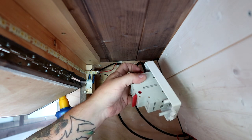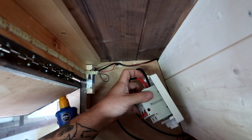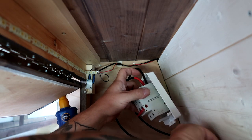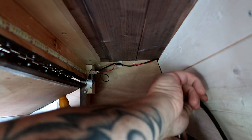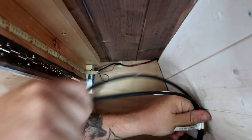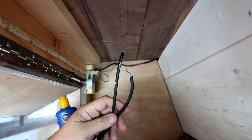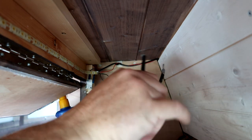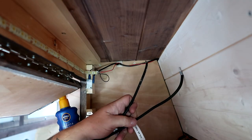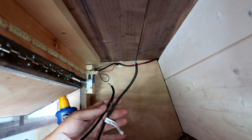So what we'll do now is cut the panel wires down to size and fit them underneath. And I know I've got bare wires on the end of this, people, but don't worry, because I have disconnected the solar panels from the wires. So remember, if you're working with your solar panels, you've got an isolator and everything, always remember to unplug your solar panels first.